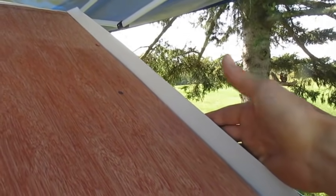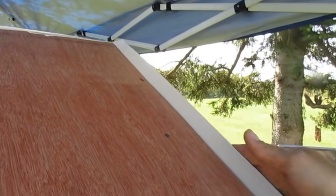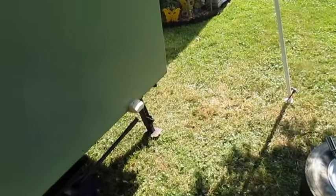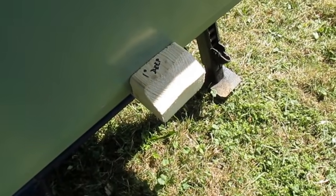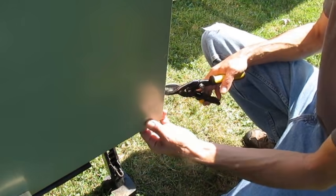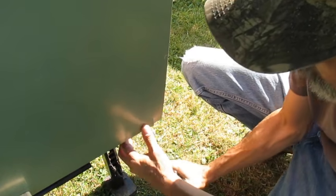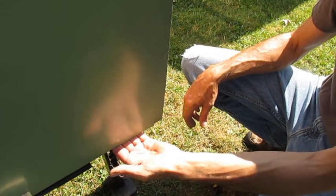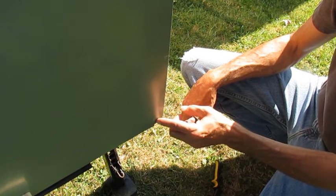My metal is on, and now you can see I've got my one inch overhang to bend over on the roof. There are the jigs holding the metal and leaving me the overhang on the bottom to bend under the floor. Now here on the back corner, right where the wall ends, you just want to cut a slot so you can bend this metal around and it can go underneath the trailer. Without this slot it'll create a triangular wrinkle right here, and you don't want that — you want this metal to pass itself, get pounded under, and the other part pounded around.